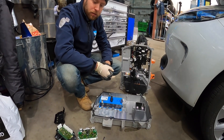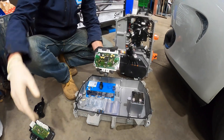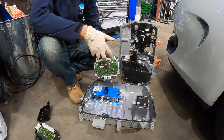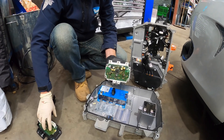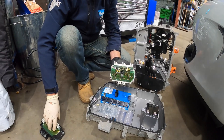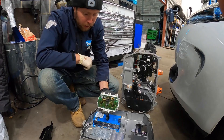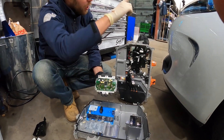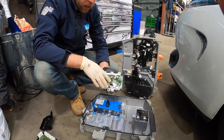So what's actually causing it not to charge? It's this unit here — the rectifier. We knew we had a decent supply up to this point because we can read the voltage measured within this unit using the diagnostic tool, which rules out anything before here. From here it goes into this inductor and through the motor windings — we can test those manually with a multimeter to make sure they're okay — and we've found the fault to be within this rectifier unit.